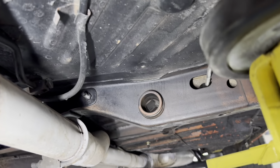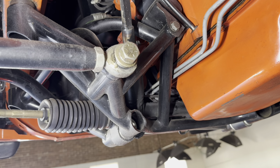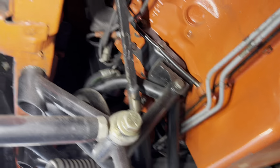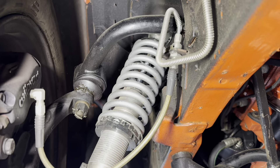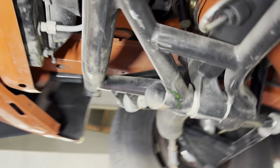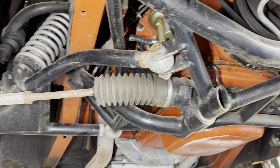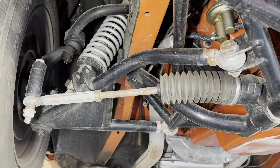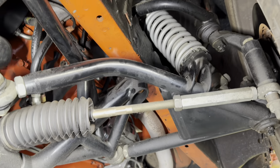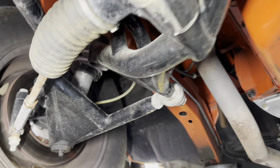On a stock Mopar you see the torsion bars - the bar goes through there up to the lower control arm. Obviously it's all been removed on this because it has the tubular k-member and control arms. My dad's strongly considering trying to go back to stock on this, but I'm actually curious - I want to drive this back-to-back with another B-body that's stock and do a comparison. I've never really had a chance to drive one of these back-to-back, and the car looks really solid.